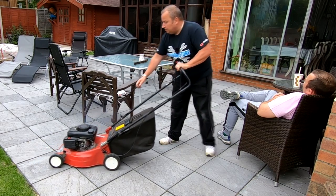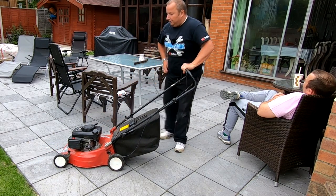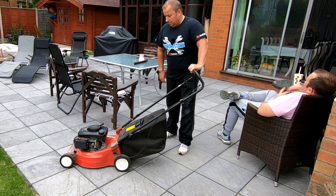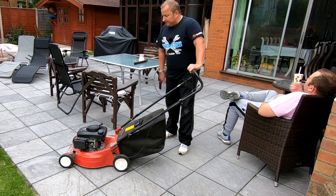As I was pushing the governor arm you can see just in there — it pushes the throttle lever backwards and forwards — well that was actually stuck. After pushing it a few times it freed off. I started it up and it started. So let me show you — it's priming — there you go, maybe running a bit slow but I'm sure we can speed that up.